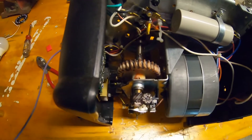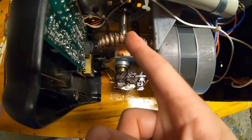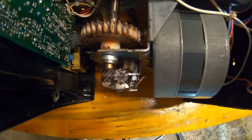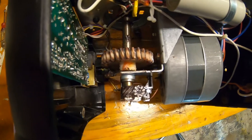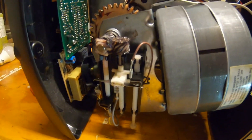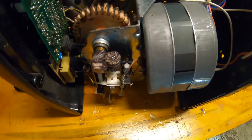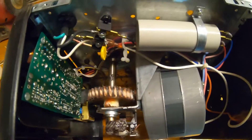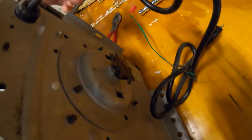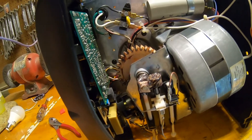What comes in the gear kit is this whole assembly — the worm gear on the opposite side from the motor that drives this gear. These gears aren't in terrible shape, but again given their age I think it's probably time. There are also a couple of bushings in there. According to the instructions, this is a type 1 opener because it has a limit switch assembly, which controls how far up and down the door goes. So it looks like we have to take out this whole plate assembly up here — there are some quarter-inch screws in the bottom to do that.